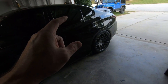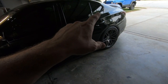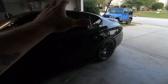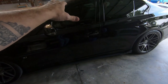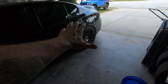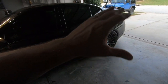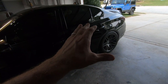The reason I didn't stiffen the rear end any more was because any stiffer, it tends to bounce. I don't mean the coilovers bounce — I mean the whole rear end of the car bounces, because there's no weight in the rear. If you have passengers in the back, it's not so bad. But in my case I'm driving alone or with one passenger — I don't have people in the back seat ever. So all the weight is in the front. If you hit a bump, the rear suspension being so stiff, the whole rear end bounces and you lose traction a lot easier and a lot faster. Smaller bumps cause you to lose traction, and that's not good.